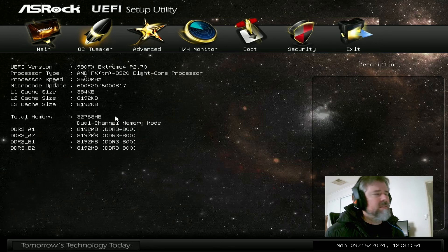Today we are going to overclock it to 4.8 GHz to really bring it to life and make it shine. I've got 32 gigabytes of DDR3 RAM in four sticks. The stock speed of this processor is 3.5 GHz and we will be taking it to 4.8 GHz, which is my 24/7 gaming setting for this processor.